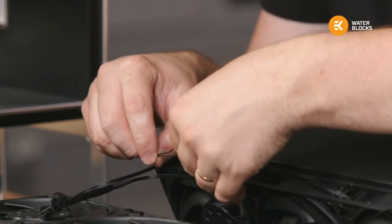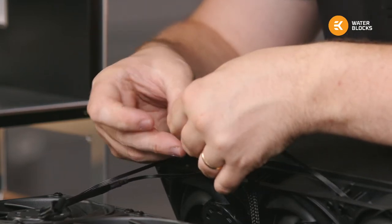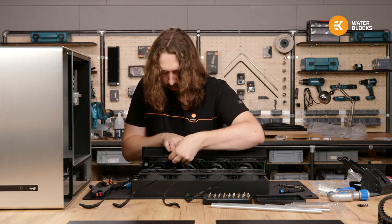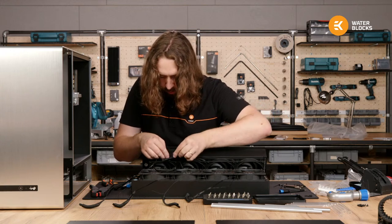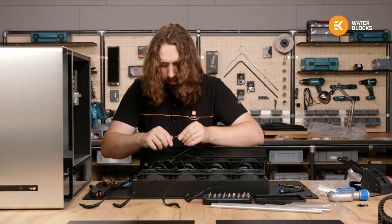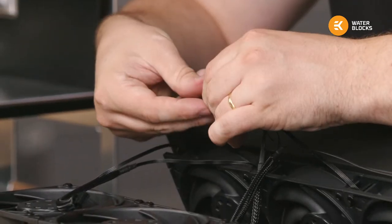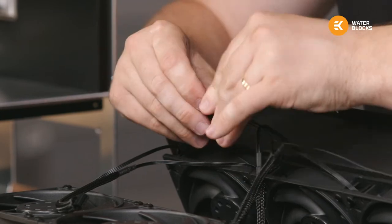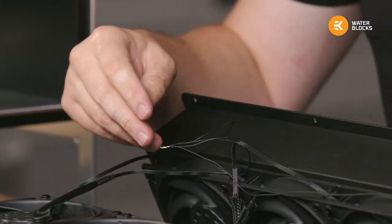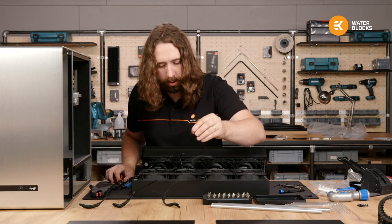And I just want to check the lengths are okay because I lost some. That's nice. Hopefully the big one. Yeah, great. So now they're all together. I'll put a little solder before crimping just to make sure one doesn't escape, and do the same with the radiator too.